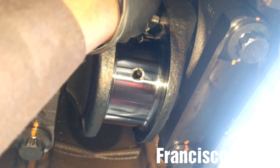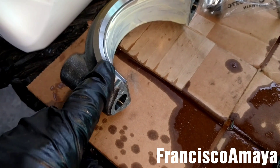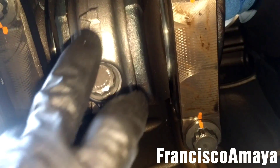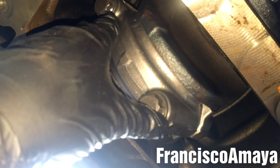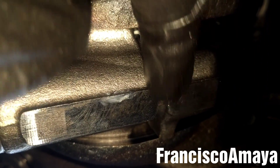Now I have to align it and pull it down so it can sit on the crankshaft — like this. It's completely seated on the crankshaft. Now I have to place the cap in the same direction as the connecting rod, with the arrow to the front. Remember the cap has to have the bearing and the new bolts at the same time. The cap is already in place. We're going to torque the bolts to around 50 pounds. It has to be completely sealed — you should not see a groove there. You can see it's completely sealed, the separation between the cap and the connecting rod. This completes the piston installation.